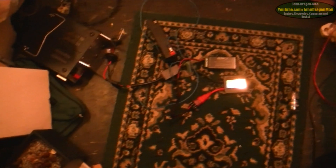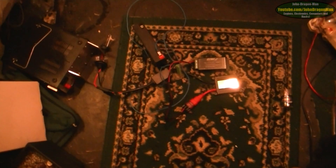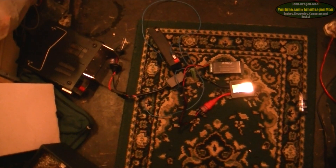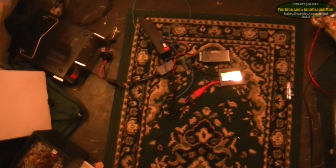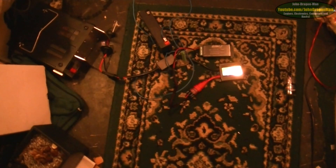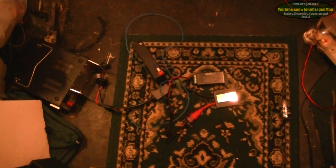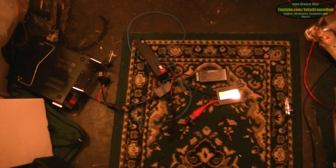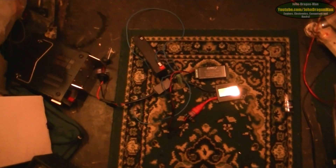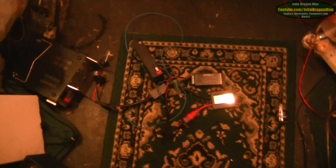The old 6 volt systems — if you don't have a load resistor on the generator — you get voltage spiking all the way up to about 30-odd volts. On the old MT-50 we found that if you unplugged the battery, it would spike up to 30 odd volts. That's because the battery was being used pretty much as a rectifier — a place to dump excess power — which is why it used to boil the cells and turn it all into hydrogen. I used to melt bulbs on it — not just the filaments, but the actual support legs inside the bulb used to melt, right up to the beaded glass that held the two legs together. Crazy voltage.